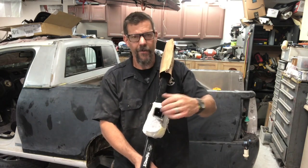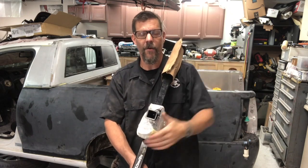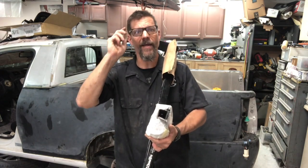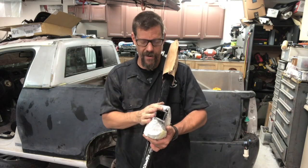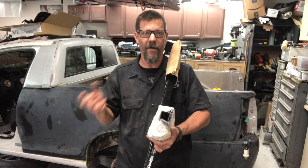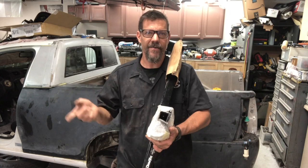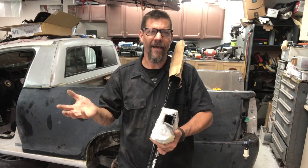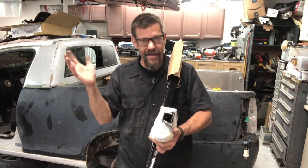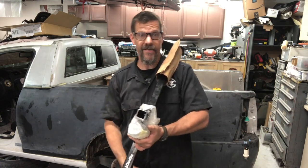You have to put your drop hitch in upside down so it raises the ball, or your trailer will be sitting really nose-low. The rating on it is 150 pounds of tongue weight and 1,500 pounds of tow capability. That's not too bad, but 150 pounds tongue weight is less than I like — I can't put a motorcycle or jet ski on that. A couple of bicycles is okay. So it's not bad, it works, it's a whole lot easier than trying to fab something up.